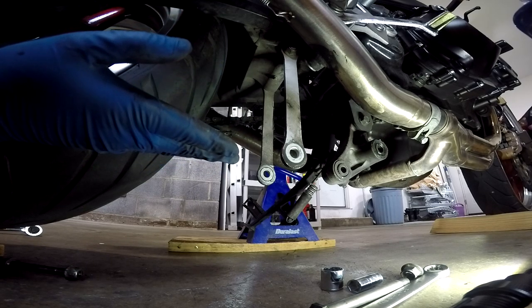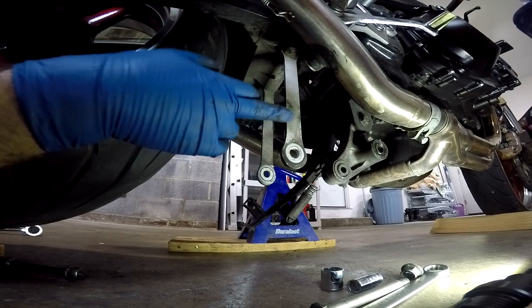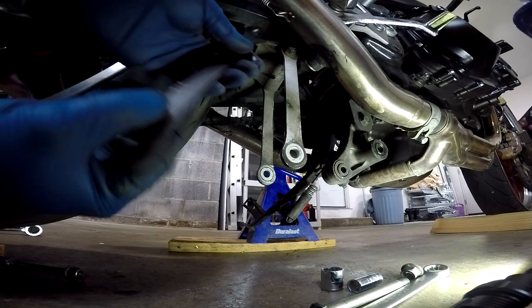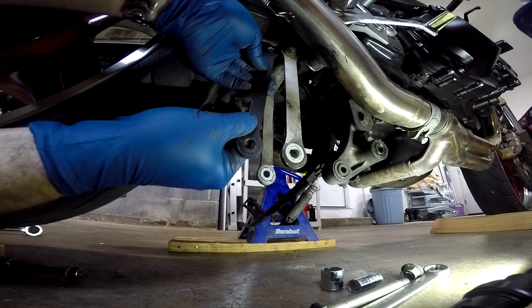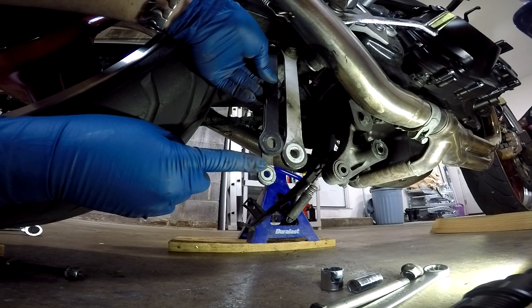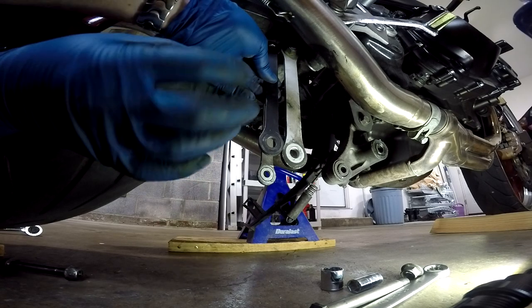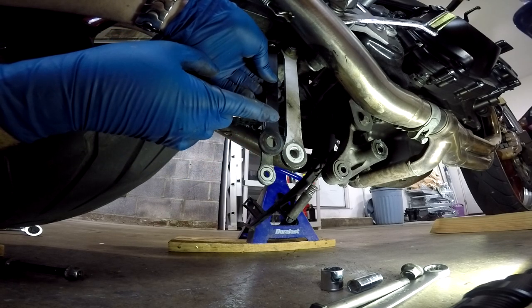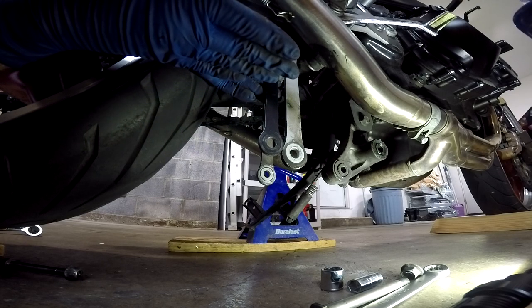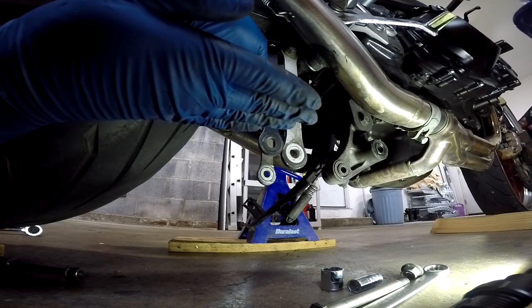When I bought it, it was actually raised a little bit. I took it and put it back down to stock height. So these are the stock size dog bones, but here are the dog bones that he had on the bike. As you can see, if I put them up here, they're about a half an inch shorter. By putting the shorter dog bone on, it actually raises the bike. So it's kind of opposite thinking — if you shorten the dog bones, it raises the rear end. If you make the dog bones longer, it lowers the rear end of the bike.